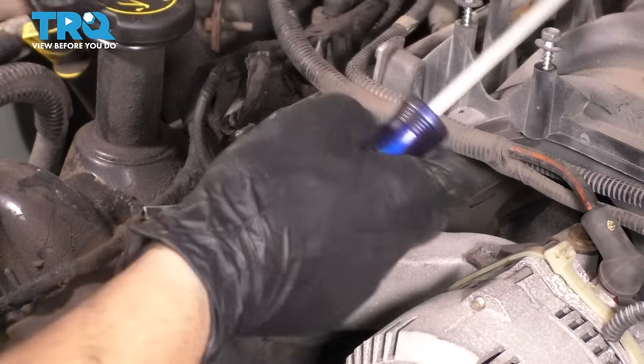So you need these. Well, you don't need them, but they are very useful when you install the head because this one and one on the opposite end are what situate your head and your head gasket perfectly so that it lines up so you can just drop the bolts in and tighten them up without worrying. So save these.